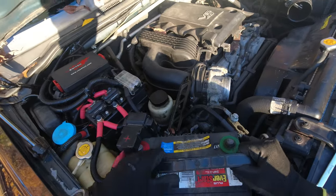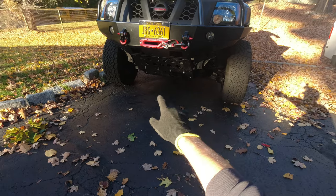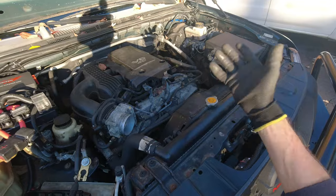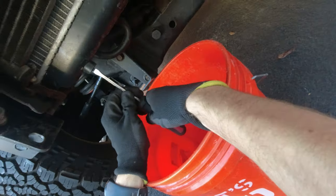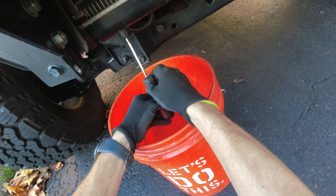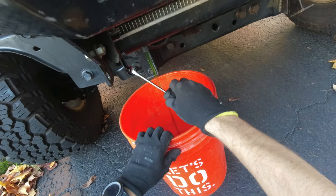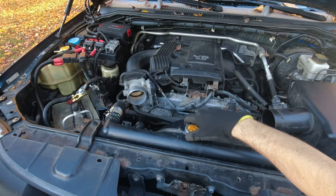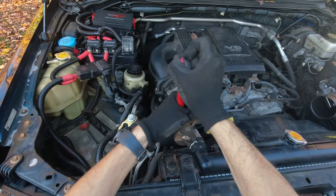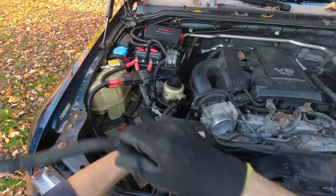Now I'm gonna remove my battery and take it out completely. I just have to remove my skid plate so I have better access to all the hoses down there and can drain the fluid. Once I drain the fluid we can disassemble all of this and pull it out. With a big flat screwdriver, we unscrew this plug over here and drain all the antifreeze out. Now we can open this so it drains better, and with channel locks we can undo the top hose clamp. The hose is out.